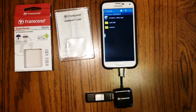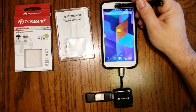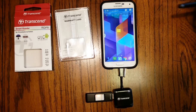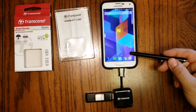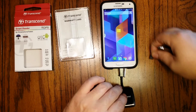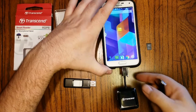Once you're done with your card and flash drive you'll need to safely remove those from the hub, and this is how you do that. Just go back to your home screen, pull down from the top, and you'll see where it says USB mass storage connected. Select remove USB mass storage safely, press that, and then at the bottom of the screen in just a moment you will see it flash up: USB mass storage removed safely. Which means it is now through reading and writing to the card and the flash drive, and I can simply pull those out at this time with no danger of corrupting a file.